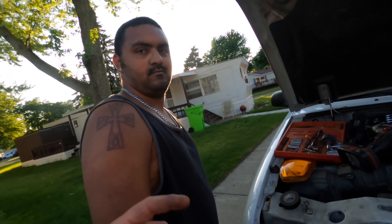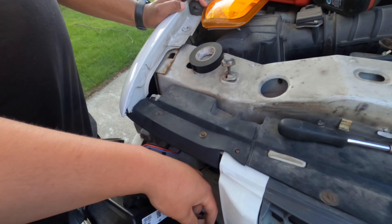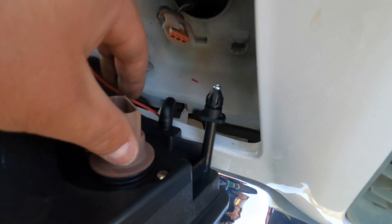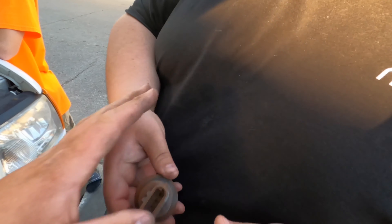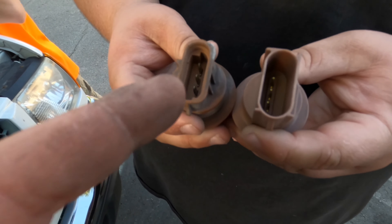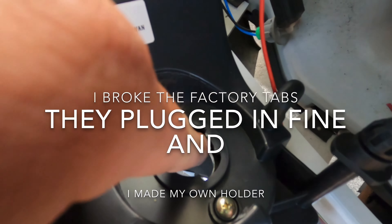Alright, well we can't let this guy buy anything apparently. The connector that comes on the headlights fits in the housing fine, but the factory plug is not the same - the pins are spaced differently and the connector is a flat plug. They're different, but we're going to make this work - I might just trim this off a little bit.